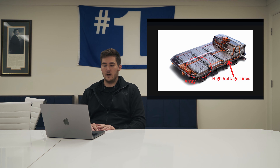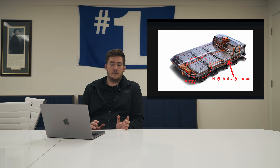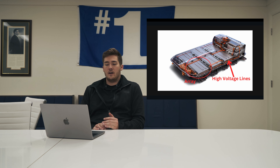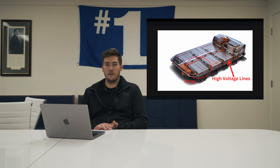These arrays are the cells of the battery. There are typically 10 to 12 in a Ford EV. Let's say one of these goes bad — it happens. One of these arrays can go bad. So if one goes bad, its partner also has to be replaced; the one adjacent to it has to be replaced with it. Underneath these arrays there is a plate, and each one of these batteries has thermal paste underneath it so you can transfer the heat from the battery and cool it down.